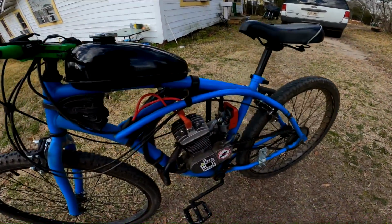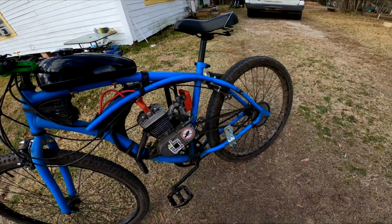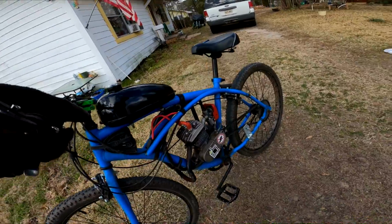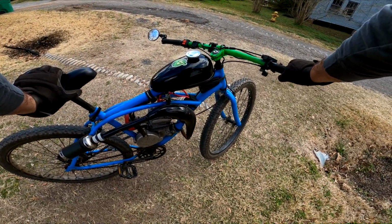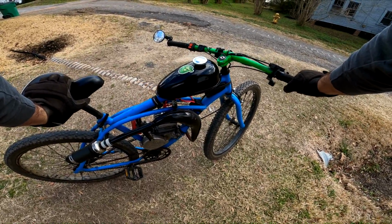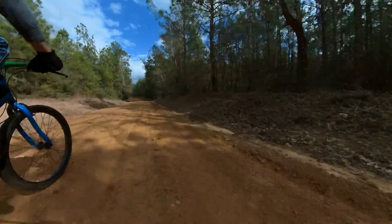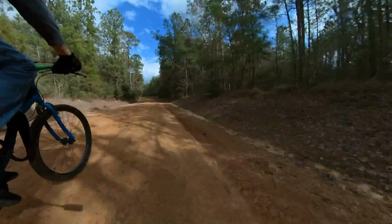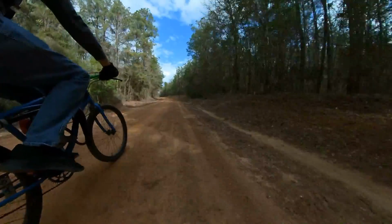I did, however, notice that we have a head gasket leak. This is easy to fix. I'll deck the head and cylinder and mess around with different head gasket materials and get that sorted out. Sitting back down on a YD100, or now an LD100, is a nice pleasant reminder of just how much practical power you can get out of these dirt cheap motors. PK80 style motors, as well as the YD100s, will probably always be a nice fallback on the channel, even when we start messing with performance builds.